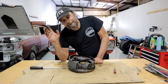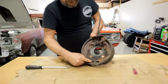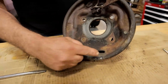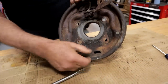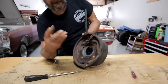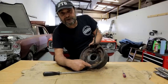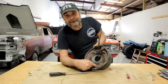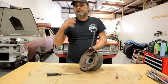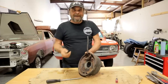On these Chryslers, the access points are usually fitted with a rubber plug just to keep water and dirt out. You pop the rubber plug out, put your brake spoon or screwdriver in there, make your adjustment, then put the rubber plug back in. Some of them have access points that aren't punched through — you'll actually have to break it out in order to make your adjustments.